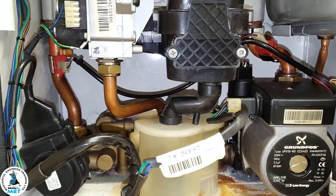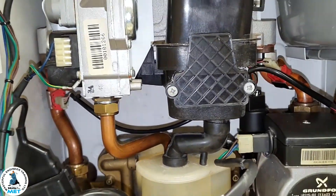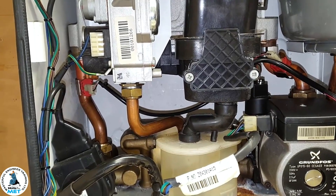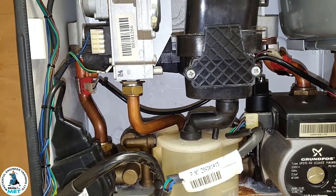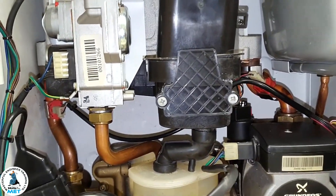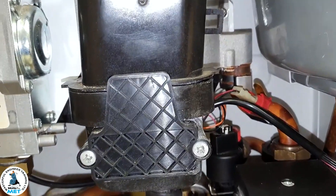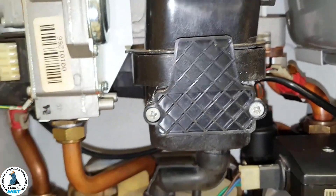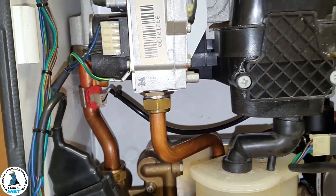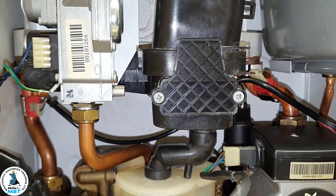These two left and right sensors are constantly monitoring each other — they work like twins. If one went awry, the electronics would detect a sharp increase in temperature and shut it down — it's a fail-safe between the two. You can also check the resistance reading between both sensors: disconnect them from the pipework so they're at the same temperature, and you should get a very similar reading. A big difference means one is faulty and needs changing.